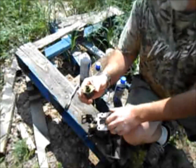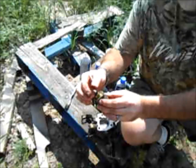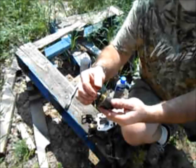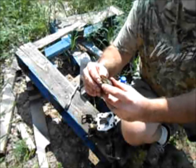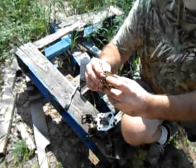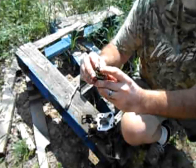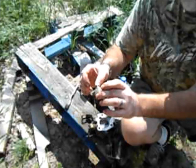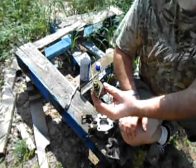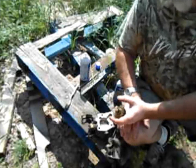And then the idle air control valve, when you clean it, just be real careful with it. You don't want to pull this out or push it in or twist it or anything like that. There's a little sleeve there where they're sticking out more, you could push that down further, but just try to get as much cleaner in as you can without doing too much damage to it, but get the outside nice and clean. So let's go put it back on.